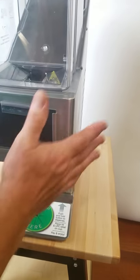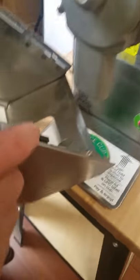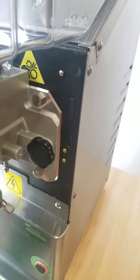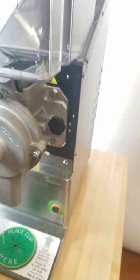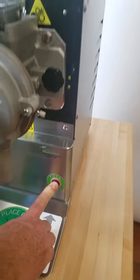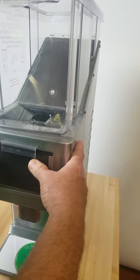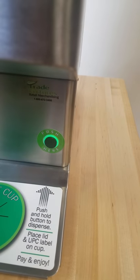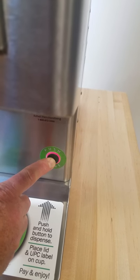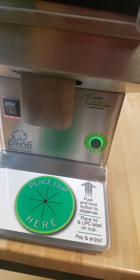The other safety feature is with the front. The front simply pulls off — rotate it down a little bit and it pulls free. There's a sensor here that mates with this slot. So now the Rhino Grinder knows the front is removed and you have a flashing red light — the machine will not operate. Put the front back on and you'll get a solid green light and the machine will run. To turn it off, hit the main power switch and the machine is completely off.